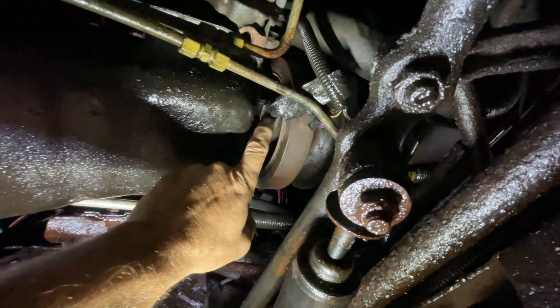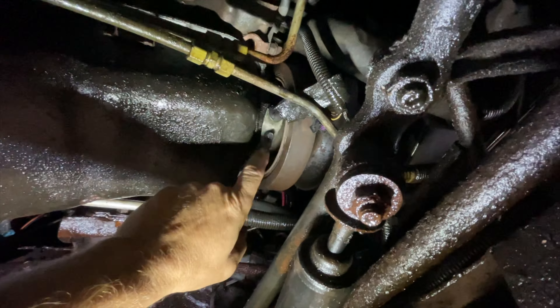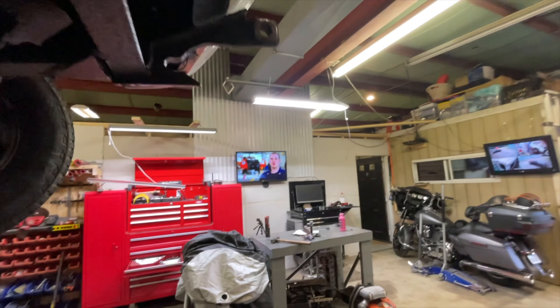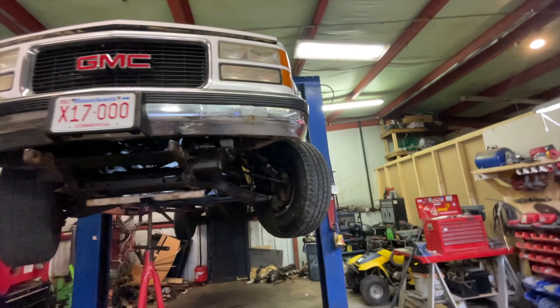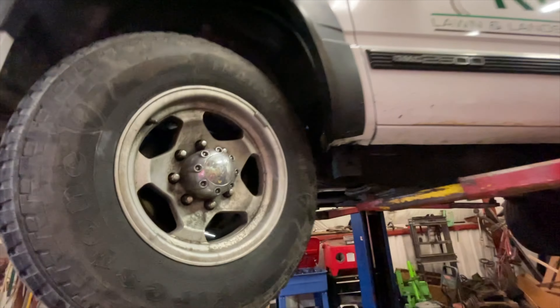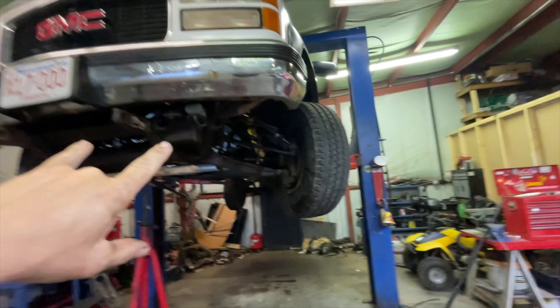I pulled the crank sensor out and I was able to put a shim in it, because when you buy a new sensor it comes with shims. I shimmed it a little bit away because it was making contact with the crank sensor, and that's what was causing the misfire. That got the truck running good, but I now had that continual knock. This truck I'm trying to get through as little as possible. This is Trusty Rusty. I did a Rust-Oleum spray can because it has a rusty frame.